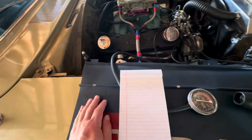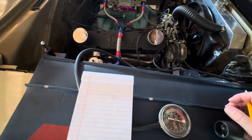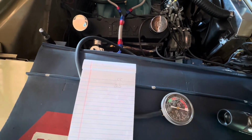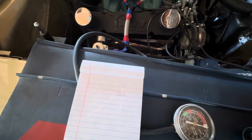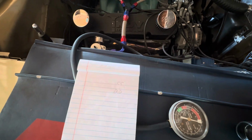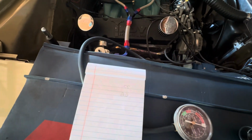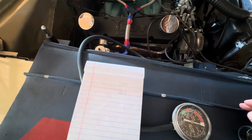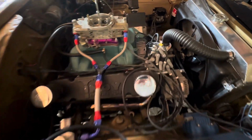Hello. So I pulled down 2 videos I made yesterday, and I wanted to do a video on why. It's because I made a mistake. Because getting these timed with the Vacuum Advance is definitely confusing, especially when you've never done it before. I've always worked with MSDs with just either locked out or initial and then mechanical advanced, limiting the advance. But this is a whole nother game, running with a Vacuum Advance.